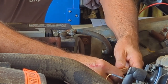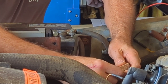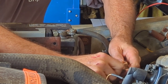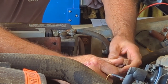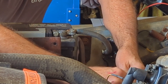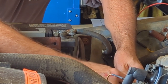I'll grab my test light. I have a multimeter and test light, but I like doing the test light for quick checks. If you need to know the amount of power going back, that's where you would use your multimeter — say you're still not getting full power. But a test light is usually a pretty good indicator you're getting power. So when I get this cleaned off, I'm going to jumper this with a jumper cable.